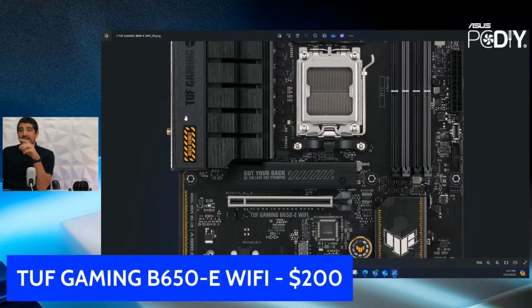Now that's still great because I want to know what's the fastest device you have. For most users, based on our polling, most users only have a 5 gigabit device. Pretty much every peripheral you have is going to be USB 2. And then if you have something faster, it's probably going to be maybe an external SSD, which for most users is only a 5 gigabit USB. So already with 10 gigabits, that's twice as fast. And with 20 gigabits, that's 4 times as fast.